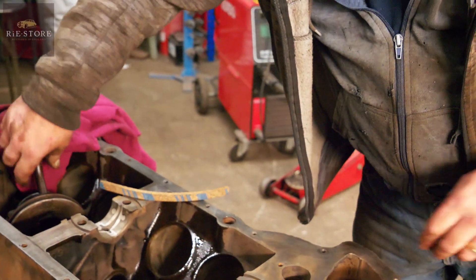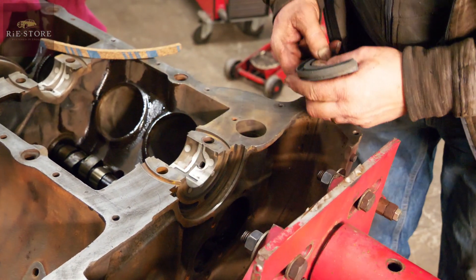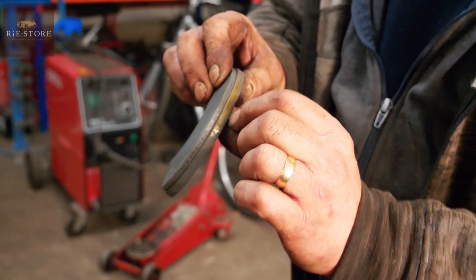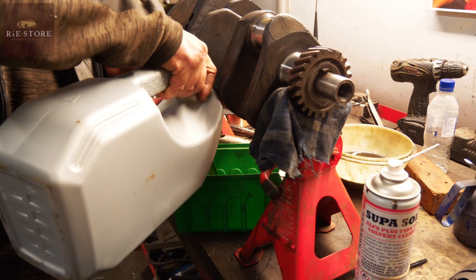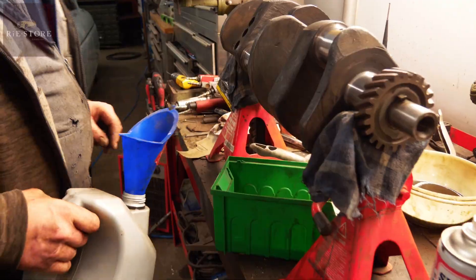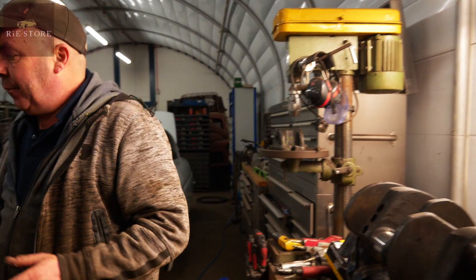You've got to make sure there wasn't anything else in there. Just got a bit of goo around that - you can see that's had sealer on it. It's what they call shellac, it's like old varnish they put on them. Why do you soak them in oil then? They're like a rope seal - if they're dry they just burn. You have to soak them in oil. As soon as oil gets around it from the engine it'll be fine, but if they haven't got any oil on them they'll burn the minute you fire it up.